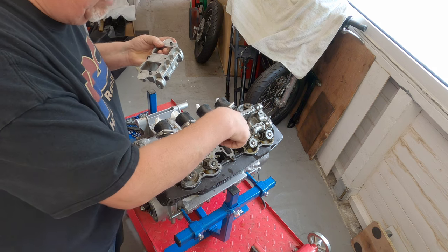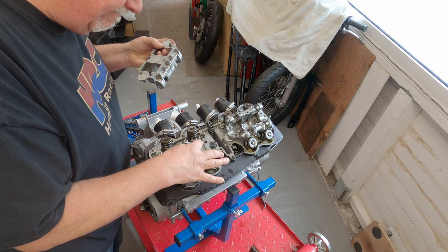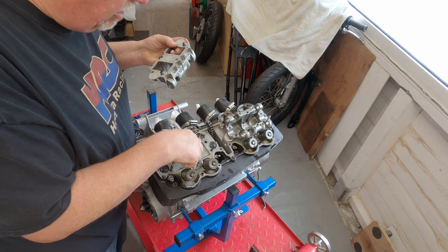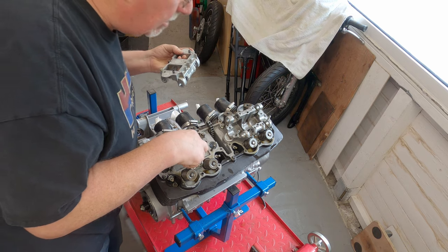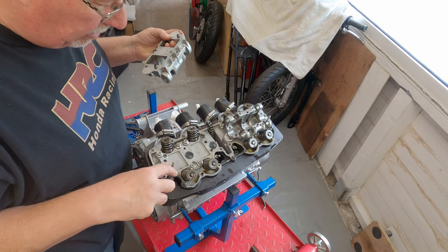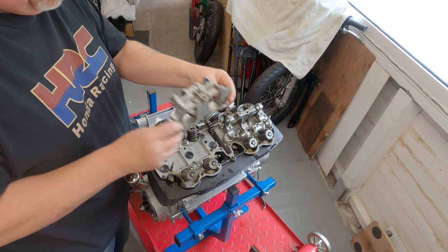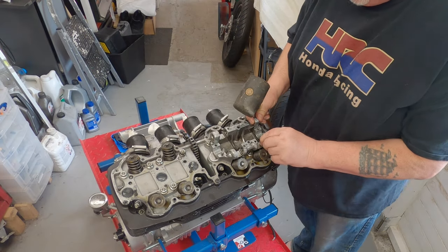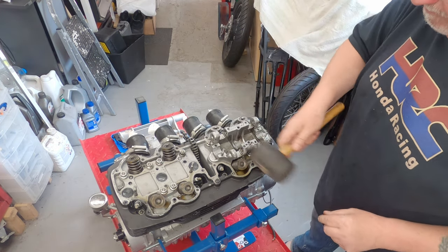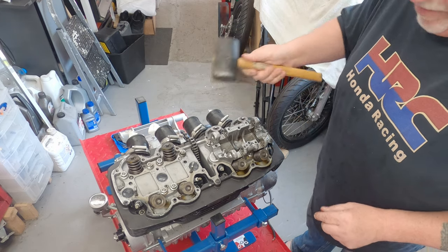And to be honest, it's going to be the one over here, I think, that's going to be the issue. They don't look like they've been breached, but there's also an oil feed jet here. There'll be another one at the other side of this, and there's an O-ring on there that looks okay. A couple of dowels to position it, looking good. It's got a bit of oil in it as well, so it's just a bit of persuasion. Nothing dramatic, just to start moving.